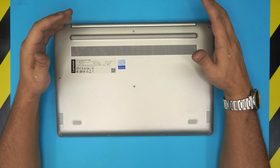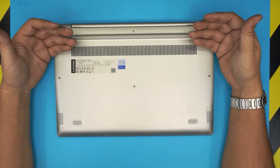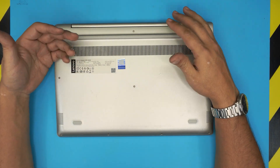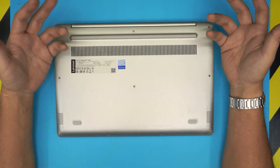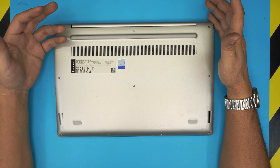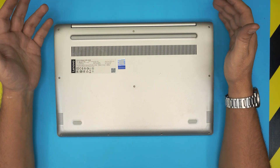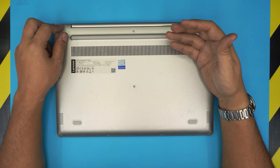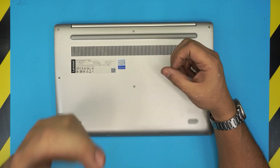This maintenance you should be doing every year or every two years. I recommend it depending on usage of the laptop, the environment, the dust — there are many factors. I always suggest every year or year and a half, maximum every two years, you should open it up, clean it, or repaste if your paste is really dried up.